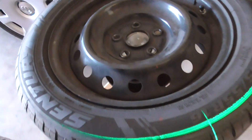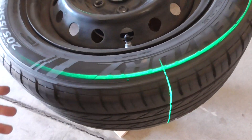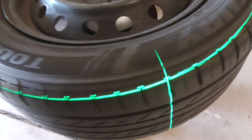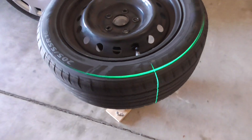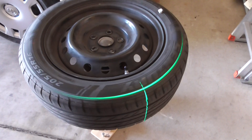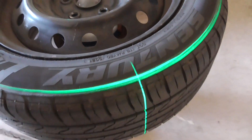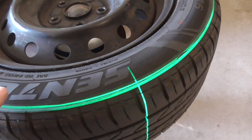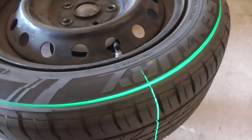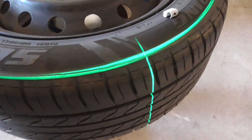It's a half-ounce weight, let's see what that does when it spins. I have to wait for it to settle. Okay, that seems to be fairly settled now. What I'm doing is looking at this spot here with the vertical line, and I think it's doing a fairly good job — I'm within half an ounce, which is probably why this wheel works on the car as it is.